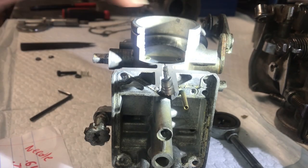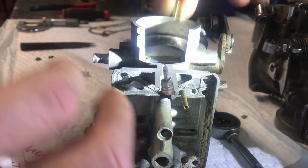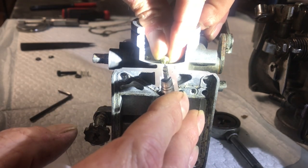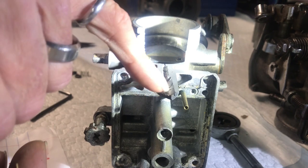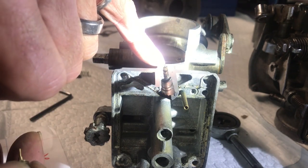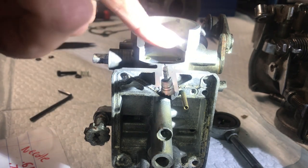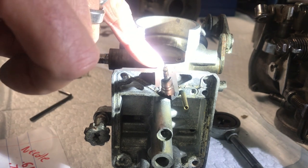If you've got one boogered up, what are your options? The hole is confirmed at 0.9 millimeter, so if the carb hadn't already been destroyed, you could take a 0.9 millimeter drill bit, come in from the back going all the way up through without the needle in, and try to work that burr out with your fingers. That could get the carb to set up better on its air/fuel idle mix. Otherwise, you're either scrapping the carb or compensating by turning out two and a half to three turns.